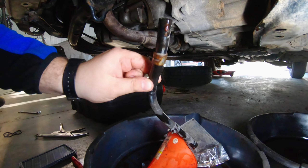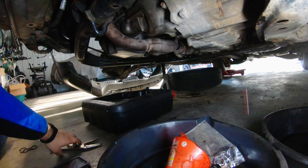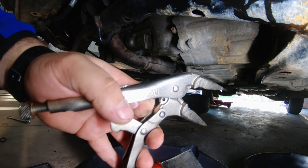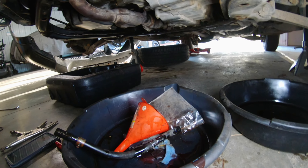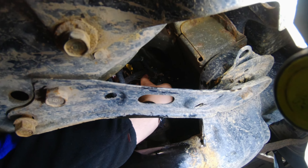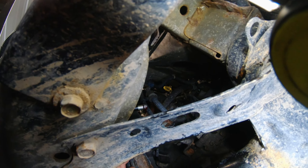Here is the hose that is removed. These hose clamps are kind of tight to get off. I wouldn't recommend using needle nose pliers because they can slip and break another line. I just grabbed some vice grips, snapped them on, and they usually come right off. As you can see it's dripping, so we prepared for that with some drain pans. You can see right over here is where the hose came off, and right up here is where it's dripping.